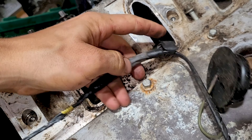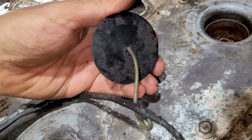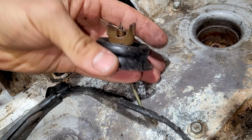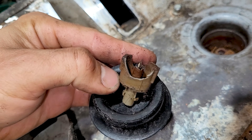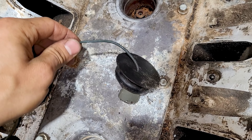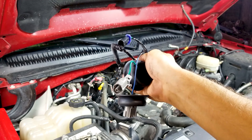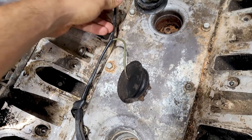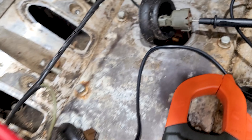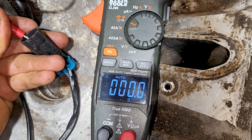When you look at these, you'll see mice will chew them — it won't read right. The wire has foam on it to protect from abrasion and heat, which normally does fine, but mice will chew it. Down near the sensor, this wire will get flimsy, hot, damaged, brittle, and weak. The main problem — if the sensors aren't reading right — is the sensors are probably bad and corroded and this connection is corroded. This is why every time you do these knock sensors, you get a new harness. Get an OEM Delphi, GM genuine, or Dorman — those work fine — but always swap this out when you do knock sensors.